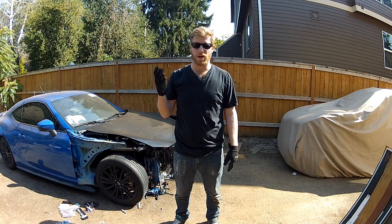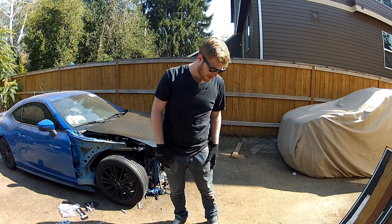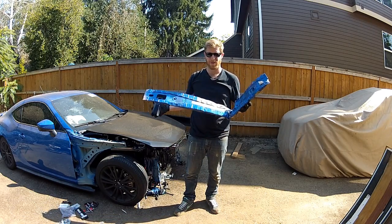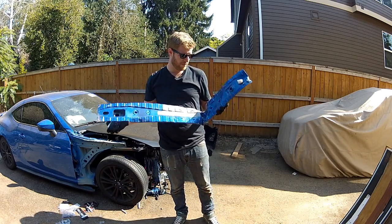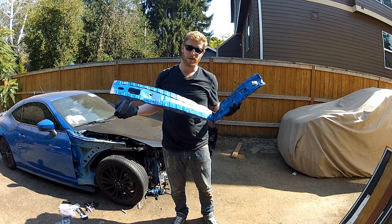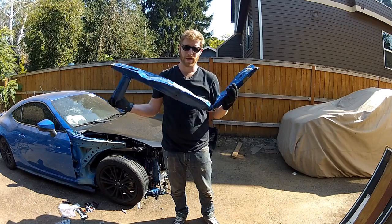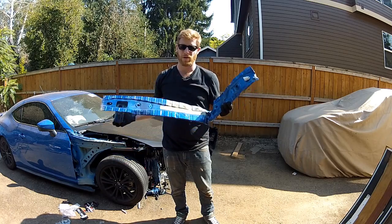Today I'm going to be rebuilding a front bumper. Some people call it a crash guard, some people call it a crash bumper, some people call it an impact bar. It sits on your frame rails in front of your car. It helps guard things like the radiator, the core support, and eventually your engine. It's meant to be strong, but not too strong, so you don't just jam straight into your frame and have the car take all the impact. It's meant to crumple and absorb a lot of the impact for front end damage.